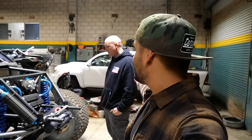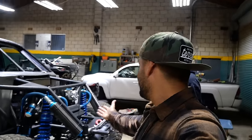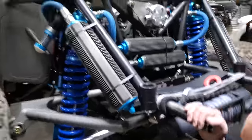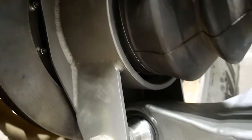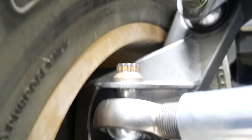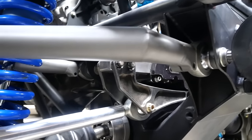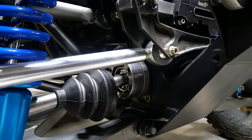The scale of things — Kirby's a big dude, he's 6'3". These tires are 40 inches. I look like a freaking nine-year-old standing next to this thing. We went inch-and-a-quarter Heims on everything just because of longevity — this truck is huge, it looks like an RC car. We went inch-and-a-quarter Heims on the upper arms, on the steering, inner outers. It's for longevity — you could get any Heim to work, but this one's going to last the whole entire season. And you're not going to be racing this thing — you're going to be pre-running and having a good time, so maintenance and keeping it dialed in matters. I want to crash into a tree and keep going.